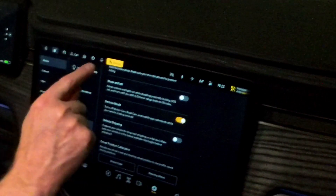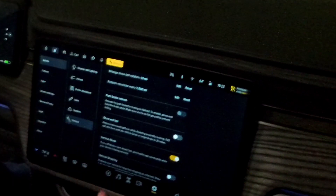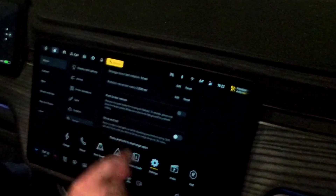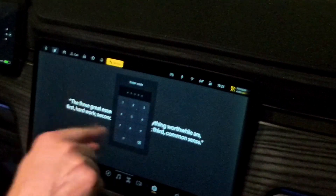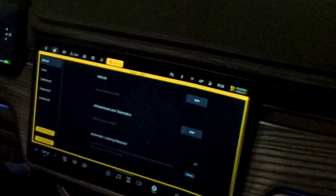We turn service mode on — this shows up in the top. We press that five times: one, two, three, four, five. This should enable the ride application. Swipe up from the bottom and hit 'ride.' Press this five times: one, two, three, four, five. An 'enter code' prompt comes up — the code is 33748. And now we are in service mode.